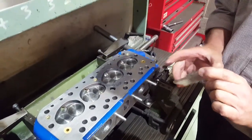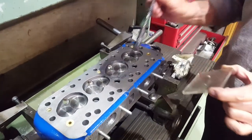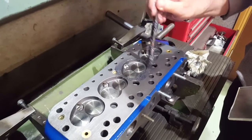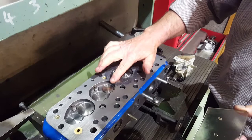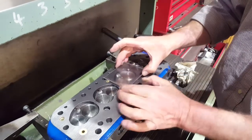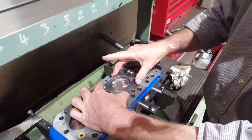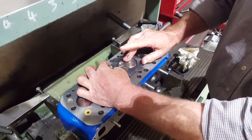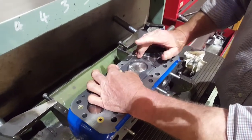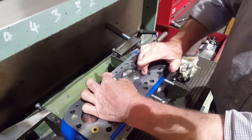Is it also to get the compression ratio right? Exactly — to make sure the compression ratio is correct. Is that just normal grease? This is just a high melting point grease; it's just the first thing we came across today. All grease will do the same job. So we'll pop the plate on the top, and as you squeeze the plate down, you'll notice the black grease has now sealed the combustion chamber.